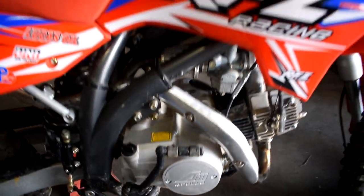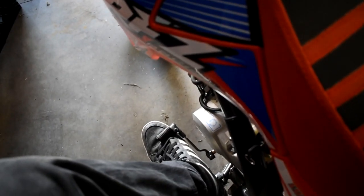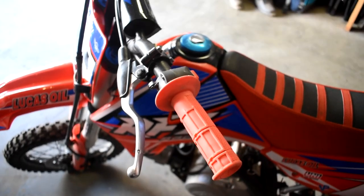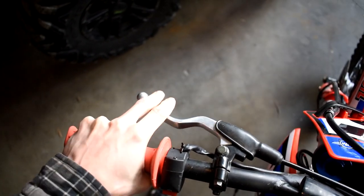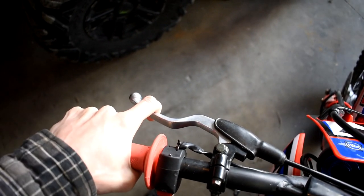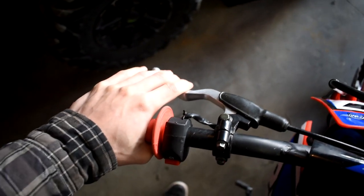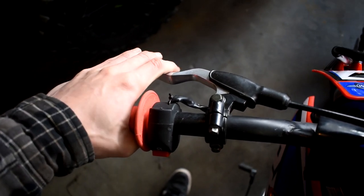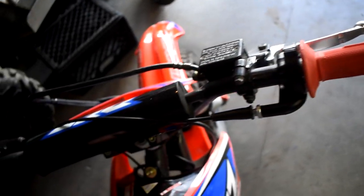The bike has enough power to be in third or fourth gear running down the road, give it a good wrap of throttle, and you can pop the front tire up to get over potholes or puddles. It does come with a four-speed transmission — all the way down for first gear, then second, third, fourth, and all the way down for neutral, as well as a clutch on your left hand. The clutch itself is on the stiffer side — I prefer to pull it with at least two fingers. Generally speaking I've had no problems slipping the clutch on trails for technical climbing. Even with the four-stroke you can bog the engine and just use a hair of throttle and this thing will keep crawling up hills no problem.